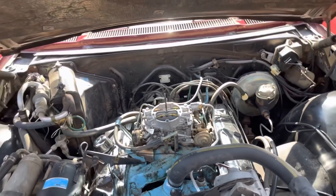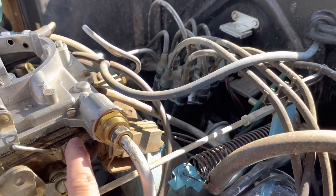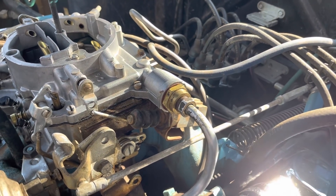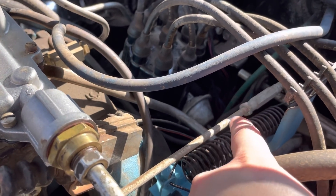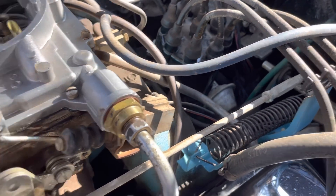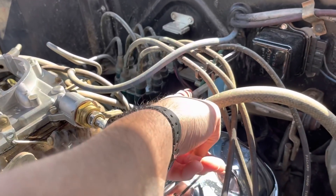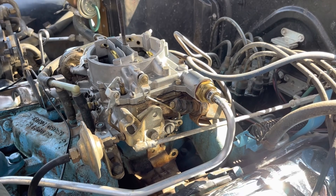The other issue I'm noticing in this car — this was owned by a literal old lady — is the kick down is not working. This is the kick down switch for the transmission. When I step on the gas pedal inside, it barely contacts it, and look how much travel there is to this switch. There's not that much travel when I step on the gas inside. I'm noticing that these old cars also have an accelerator pedal height adjustment. This adjustment has been moved all the way so the pedal is pretty much at the floor, which means I don't have full travel here, so it isn't contacting the switch and I'm not getting a kick down, nor am I getting full throttle acceleration. That's an easy fix — you just undo this little nut, spin the rod, give yourself more pedal travel, raise the accelerator pedal height, and all should be good.